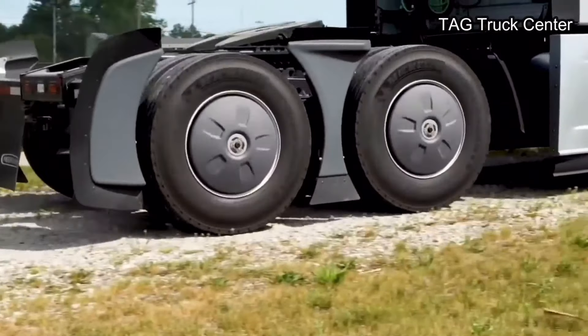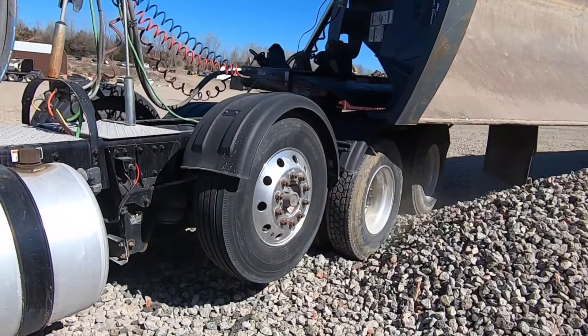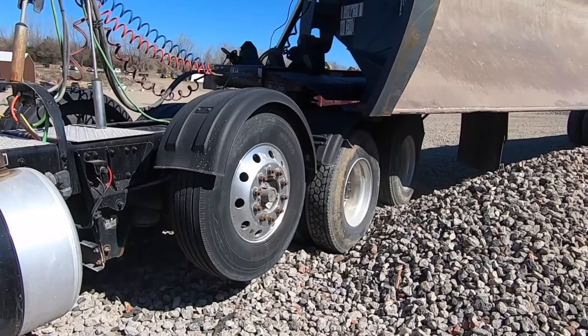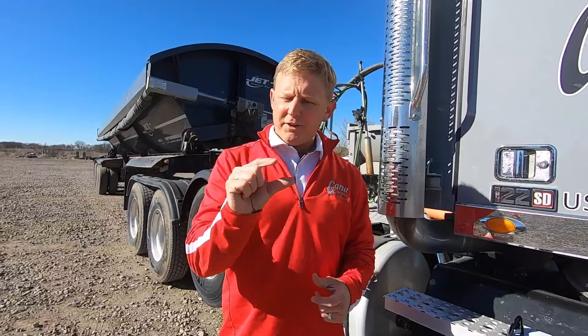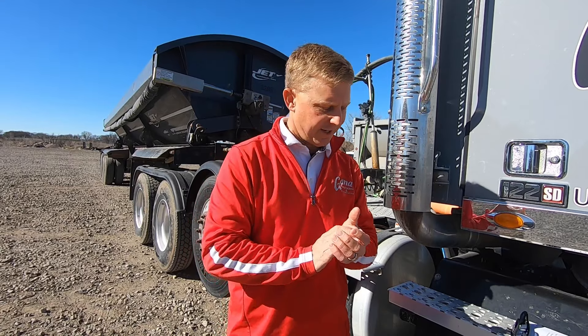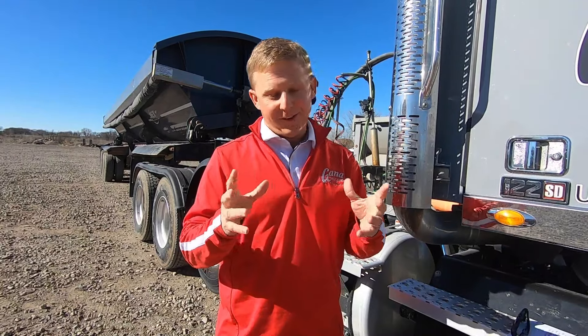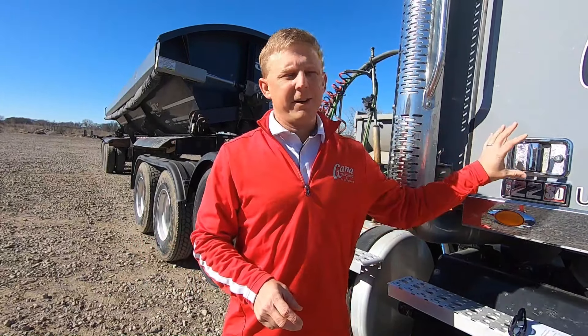The first thing we're going to talk about is the differential lock, or the diff. If you ever hear anybody refer to it as the diff, it's the same thing — it's just slang. We're going to go over what it does, what it's for, and how to use it. Essentially, what a differential lock does is require all of the wheels and tires on a single axle to spin at the same time, at the same speed. So when you run into traction issues — loose material, ice, that type of thing — the wheel with less resistance, the wheel that's in a gravel pile or on a sheet of ice, will just spin and do nothing. It won't catch, while the other wheel that has all the traction won't do anything — there's no power going to it. It's in these instances that you need to lock in the differential.